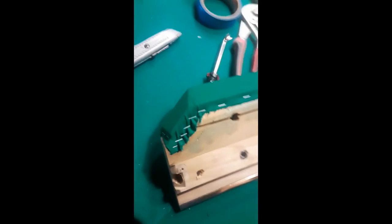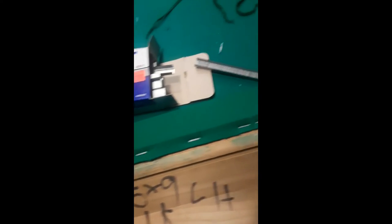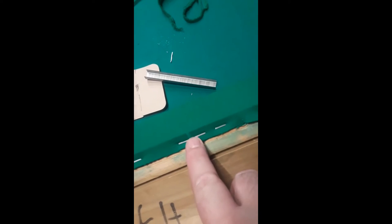Here's the finished product. You can see I trimmed all the excess cloth off. I try to stay about 3/16 of an inch away from those staples so the cloth doesn't pull out and start stripping. Down here you can see where I was going to have a little pucker where the two ends kind of came together, so I put one extra staple in there to suck that out. Here's my side pocket, kind of all done.